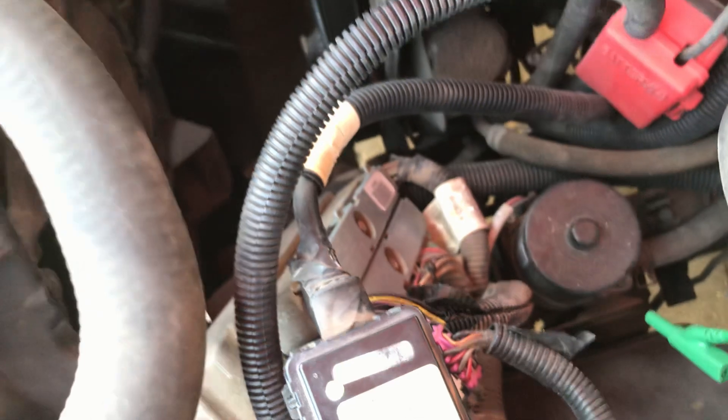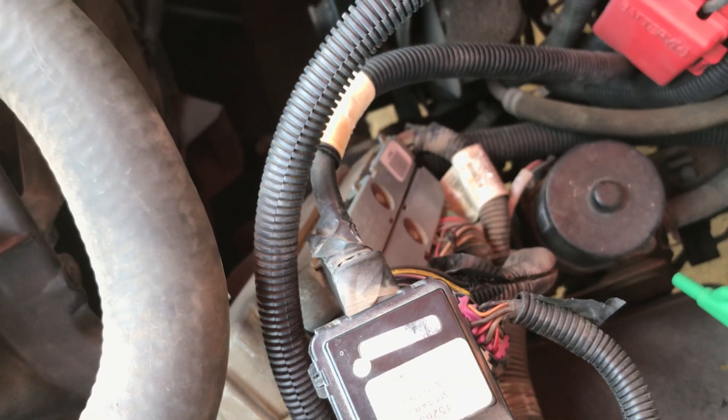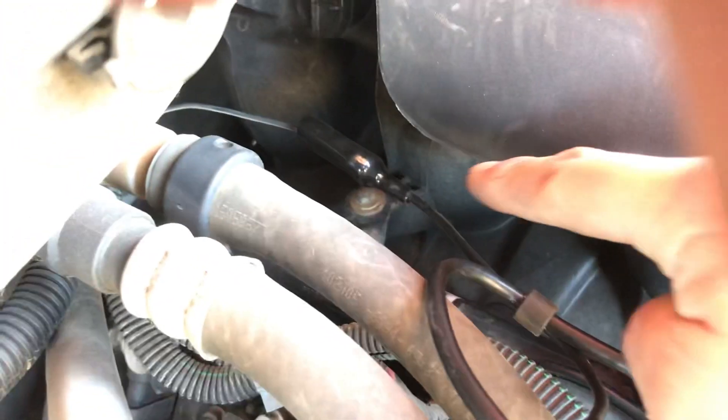This green wire right here is the GM LAN wire that goes from the PCM to that little junction box inside. That's where I tested continuity — from here over to there. I was going to look at the grounds first because there's a gang of grounds, about six, all going to one ground point — I think it's G205 or G305 or something like that.